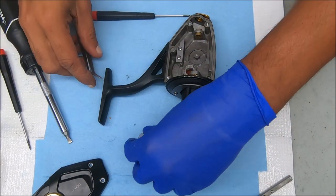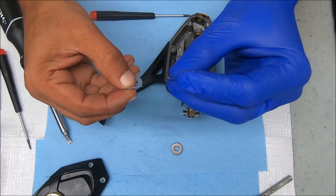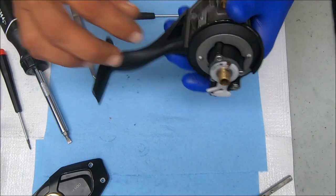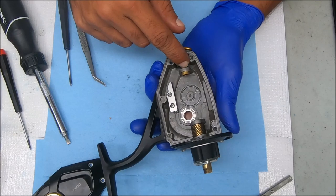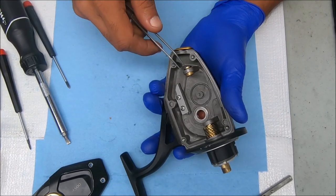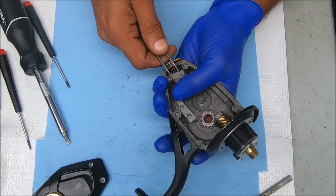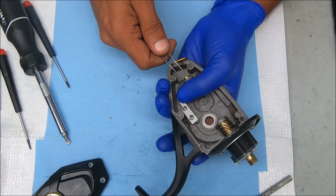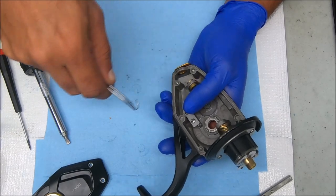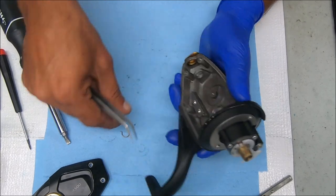Comes off like that. This has a couple of thick ones on the bottom and a thin one on top. All right, so to remove this, that bushing there, we need to pop off that clip. And this is pretty straightforward. I think it's a lot nicer and easier than the E-clips and C-clips of yesteryear. And just push it straight up and it comes out like that.